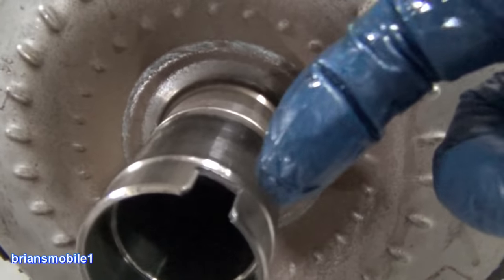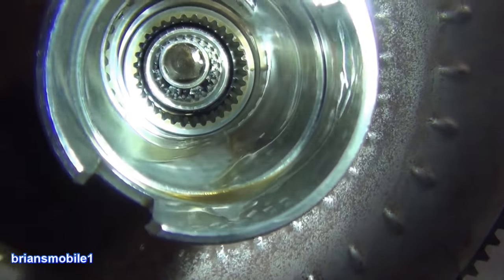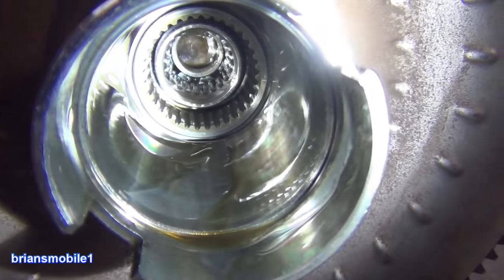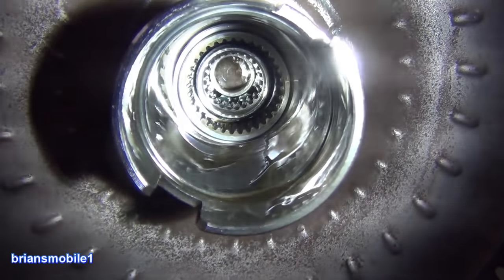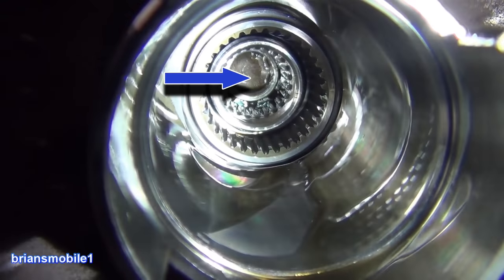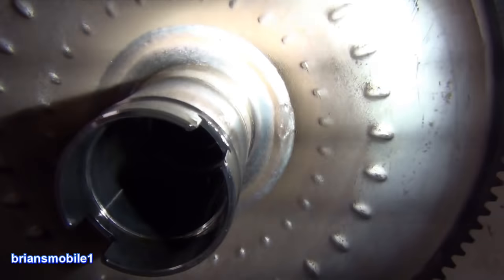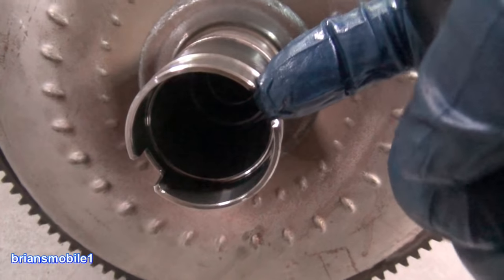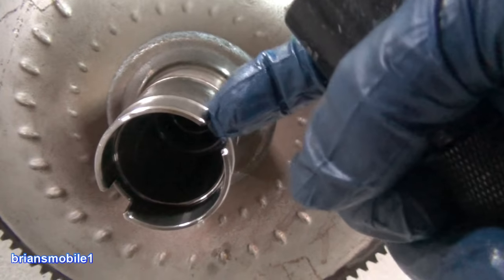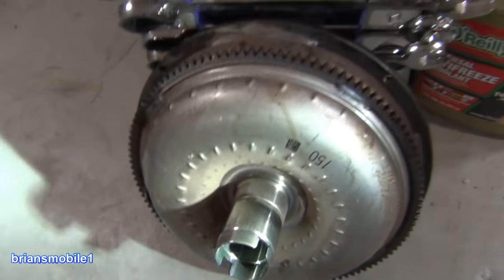You can see it's got this little thing sticking out and all the different layers going all the way down — all the different splines, a really long shaft. Pretty crazy design. You could have it stabbed through the first layer, then the second, and not make it to the third — so you've got to rotate and twist until it does go. But usually it's the front pump that you hang up on getting these to stab, and that's clipped clear back in there.